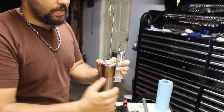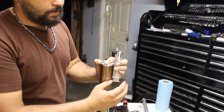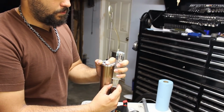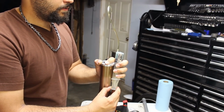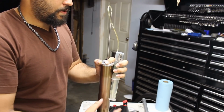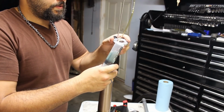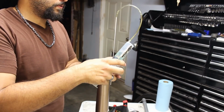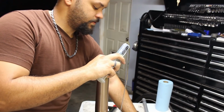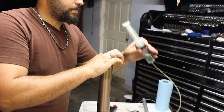If when you start pulling it, it's sucking air, you need to add fork oil until you start to suck fluid. So we'll start. So we're getting fluid in. We're going to wait for that sound. Now we have the correct level, and this excess oil I'm actually going to put back in the container, this perfectly usable fluid, so we can use it for another project.